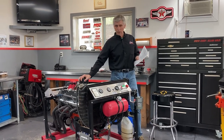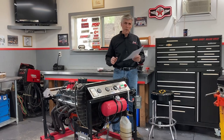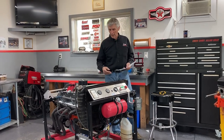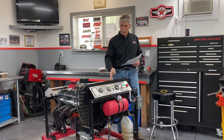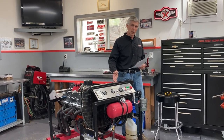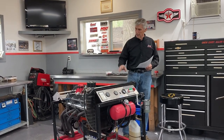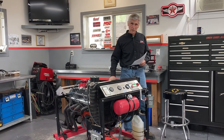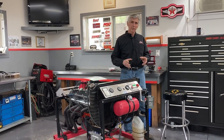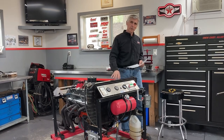We're not going to go crazy, but we're going to work effectively. I'm going to use my good friends Tom Winkler and Alex Vendrig - one on each side of the engine, and I'll be on the front. Once we shut down, I've got to get the water pump off, the pulleys off, pull the harmonic balancer. I don't think I have to take it completely off - just pull it far enough to get at that little inspection plate and remove it. While I'm doing that, Alex and Tom will be draining the water out of the block, taking the valve covers off, and backing off all the rocker arms - because you cannot advance the cam with valve spring pressure on it; the valve springs have to be unloaded.